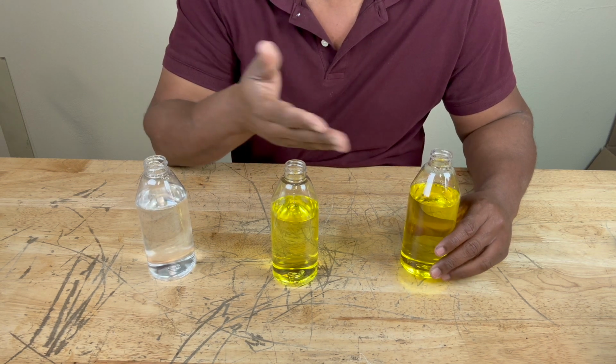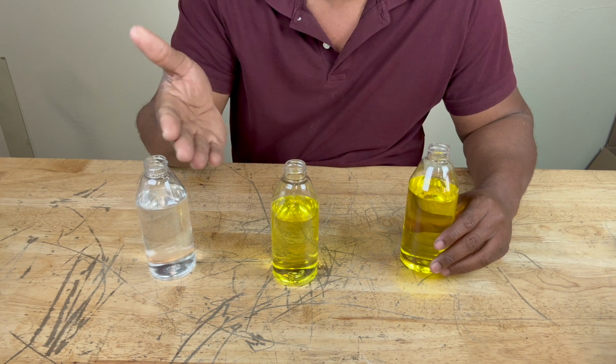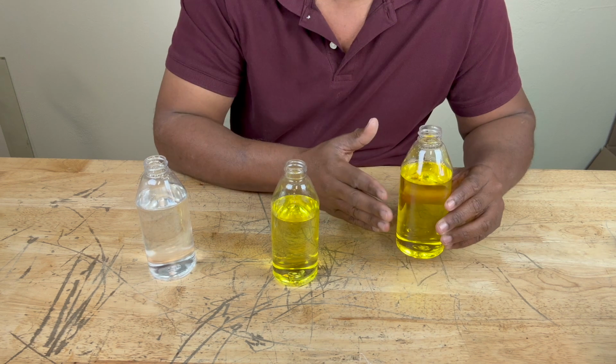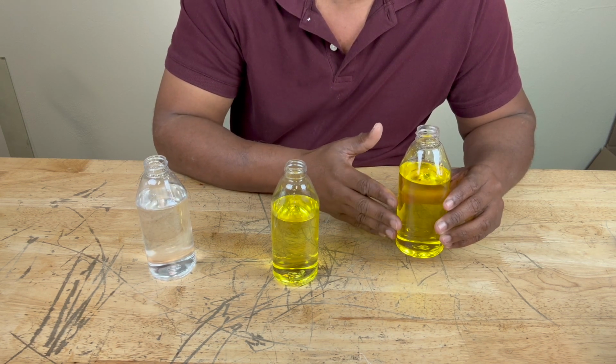In other climates, you may need a higher ratio of antifreeze, which would probably be a colder climate versus a hotter climate where you need more water than antifreeze. So it's not always a 50-50 split. The pure concentrate allows you to mix whatever ratio is needed for that climate and for that car.